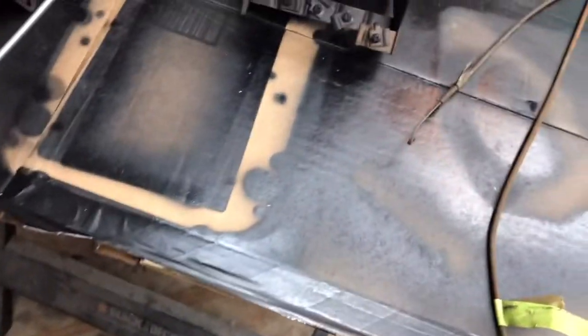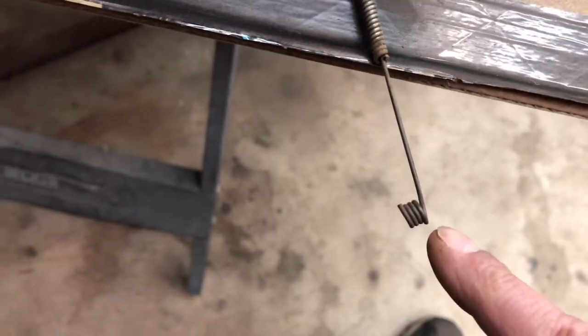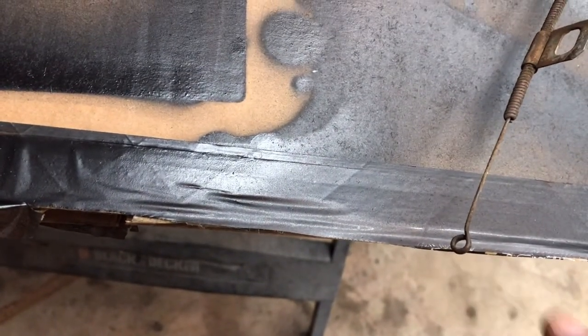I put one of these reproduction cables on here — these are very, very nice. You can only buy them in a set and I recommend buying them in the set. Here are the original cables, frozen and pretty much bad. I'm going to replace all of them. One thing to notice when you buy reproduction cables is that the larger coil goes on the control switches, but the new cables have multiple coils on each end — not like the originals.